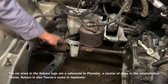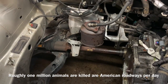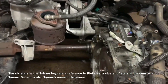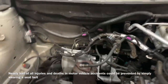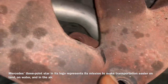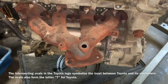Make sure when you're reinstalling the engine that this clamp is backwards. Frank explains: place it in that position and then put a little tape around it just to hold it in place when you're putting the motor back in. That mount is still hooked up and you don't really have to unplug that — it can stay all connected. One other thing Frank pointed out: on these exhaust manifolds they like to crack. We've got a small crack here — we can tell because it's black while the rest of it is rusted. You definitely want to check your exhaust manifold when you pull your engine out; more than likely it's going to need replacing.